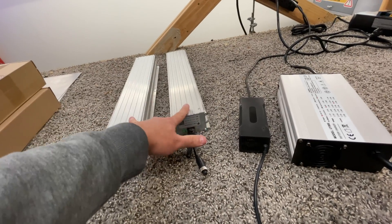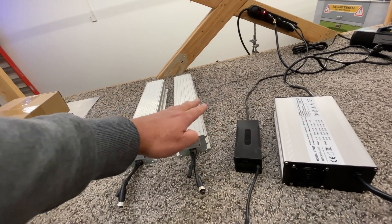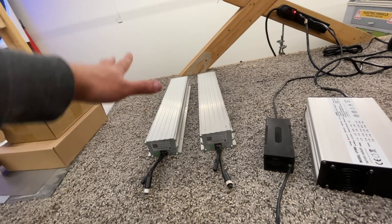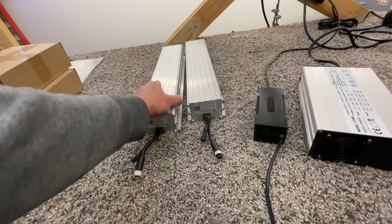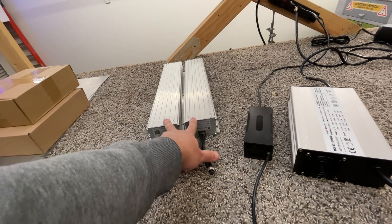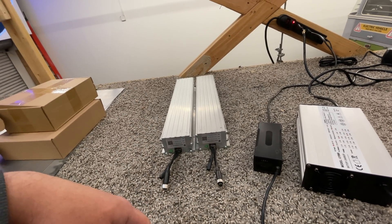So you won't be able to charge two completely dead batteries with the big charger. Once they're on and discharged, it'll have no problem. These won't go into hibernation mode every time — I think they'll go there if you leave them dead and discharged for a long time. But if you're using them every day, charging and discharging them, it'll be fine. The 18-amp charger is a bit much for a single battery, and it's not as good for them to charge that quick — you'll degrade them a little bit charging them that fast.